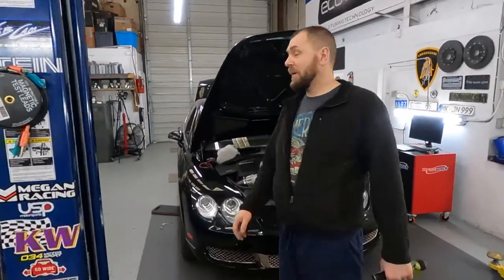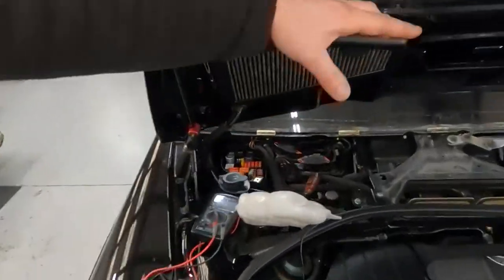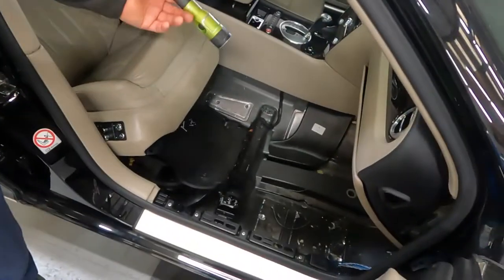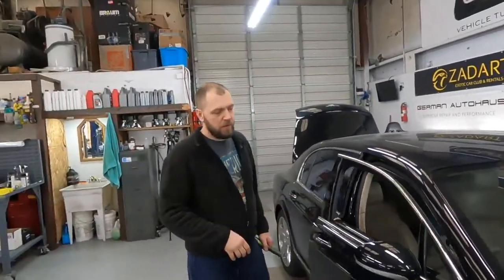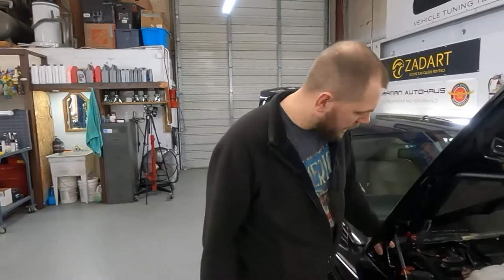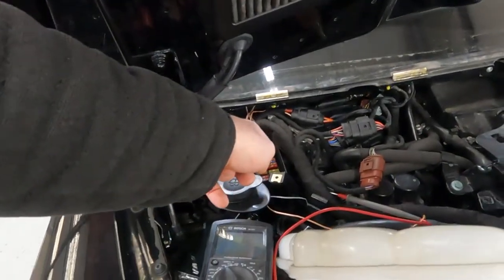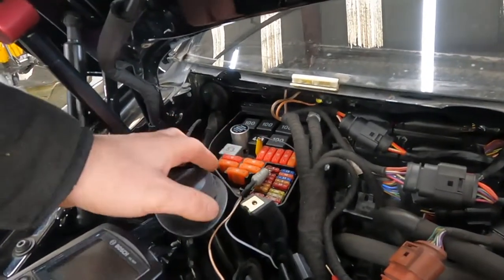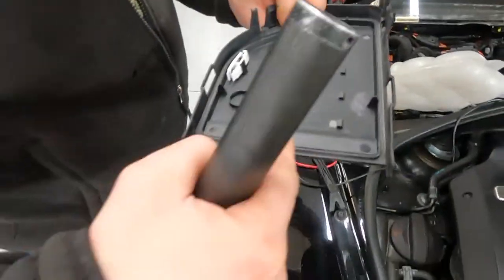Still playing with that Bentley, already reassembled this area, and you can see, guys, inside I took out the floor mat and checked the water damage. There are a few corroded wires, but the main problem here, because the owner mentioned issues and leaks from this area: somebody replaced the fuse and forgot to close this cover the proper way, and the water actually leaked